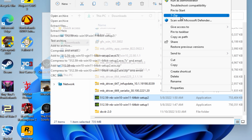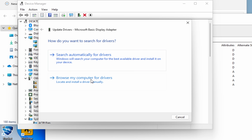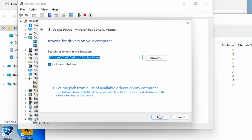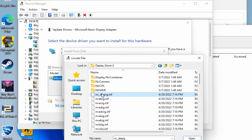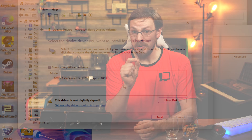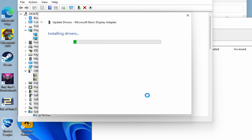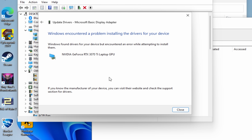While investigating the malware flag, I extracted all the files from the NVIDIA installers and attempted to install the drivers manually from Device Manager. Windows still wasn't able to detect a compatible driver automatically, but pointing it to the driver INF did show a single match. The problem is, that driver isn't signed. So, either I trust this driver implicitly with admin rights on my PC just so I can play some games, while also ignoring the fact that this installer just tried to infect me not three minutes ago, or I need to find another method. I disabled driver signing verification and attempted to install it anyway. The screen went black, and then returned with a code 43, meaning the driver failed to install or launch. So, back to step one.